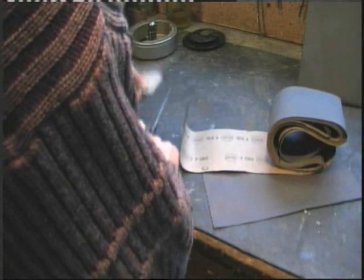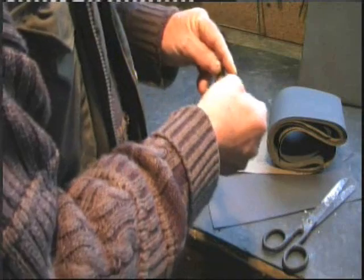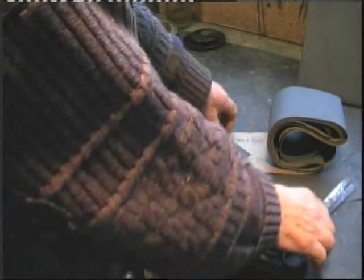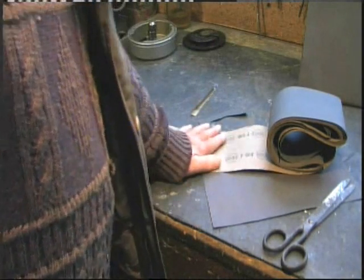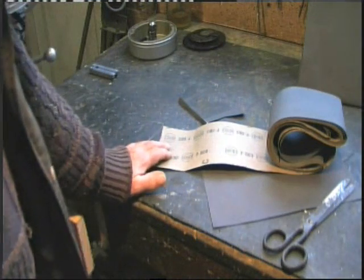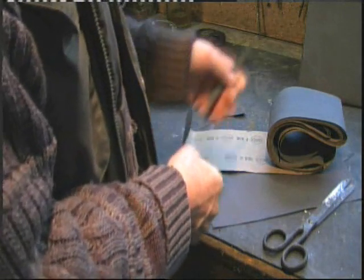With a pair of scissors, take a little strip, cut it, and fold it back on itself so you've got a double-sided piece, and you can slip that in between the points. If you want to make several, a better approach is to cut a bigger piece, use PVA glue to bond two pieces back-to-back, let it dry flat under something heavy, then cut it up into little strips. Fifteen minutes of that and you can make 50 or 60 tabs that will last you for the rest of your life.